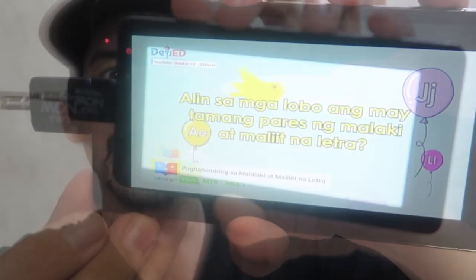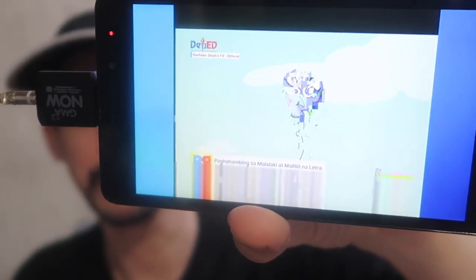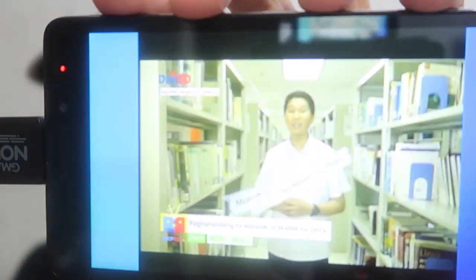We have a signal! It looks like right now IBC 13 are also broadcasting DepEd, but just by adjusting the length of the antenna. If I make it full length again, we're still on IBC 13 — full length antenna, no signal, or we get just a few blocks, but that's obviously not a usable signal, you can see it's just frozen. But if we put it back to 10.3 inches — it doesn't have to be 100% exact, but get it as close as possible — we have a perfect signal again. I'm not promising this will work miracles and get you every channel perfectly, but adjusting the antenna can make a difference.